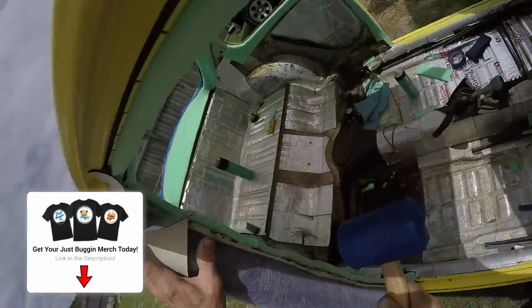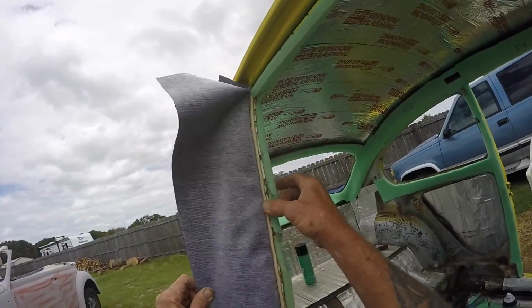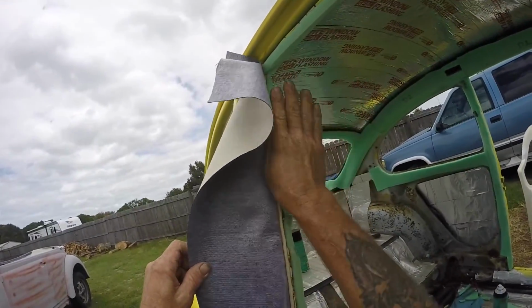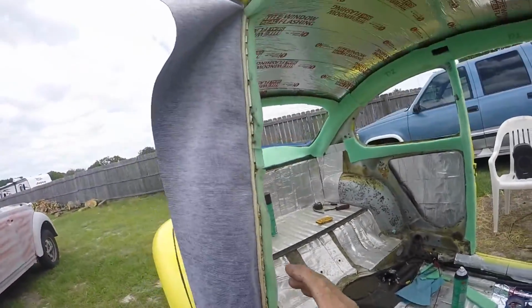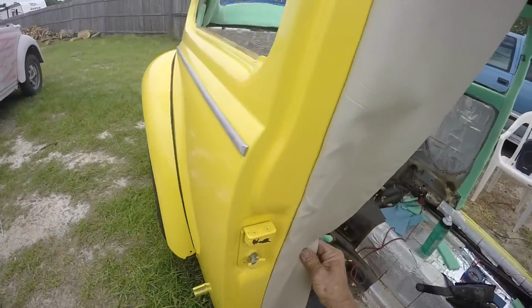All right, I'm gonna get this place up in there. You just got to get this really up in there. You want to curl that little rope seal they got, turn it that way and point it toward the other side of the car, and then make sure you're pushing it in and knock each grabber down as you go one at a time and keep looking back. You want just to see the vinyl. You don't want to see the white rope.